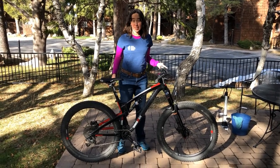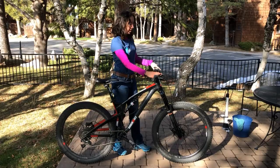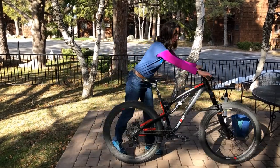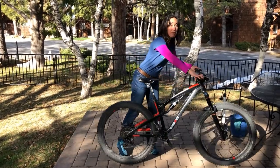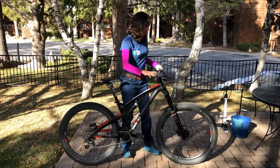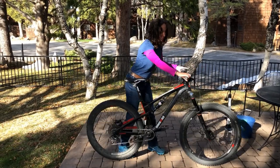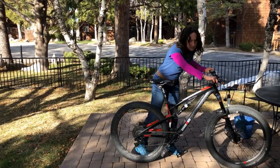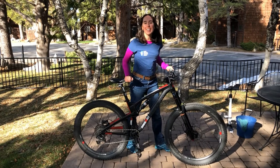So once you've filled up both tires with air, you're going to want to check B in the ABCs — brakes. Your left brake controls the front and the right brake controls the back. To check, I'm just going to move forward and make sure I don't hear any rubbing. If you hear rubbing or it's really hard to move forward, you might want to go to a local bike shop to fix your calipers. If it is rolling smoothly, I'll try pressing the front brake — you'll notice my back tire comes off, so my front one is working. Next I check my back brake: notice how the bike doesn't move in the back but the front wheel does. That means it's working. The brakes are working — that's B.